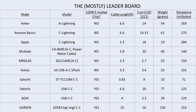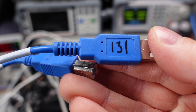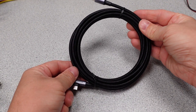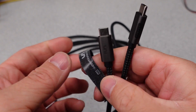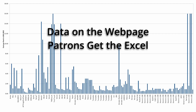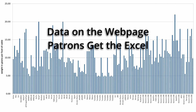Overall, Apple makes good lightning cables. Anker and Amazon Basics cables aren't bad either. For cables with USB-A connection, there are a ton of options out there, and the best way to figure this out is to look through the data for what you need. Remember, none of these will support power delivery, so you're mostly stuck with 5 volts or old versions of the QC power modes. Once you get into USB-C to C cables, basically everything on the list is acceptable. The general consensus is to use the shortest cable possible. If you need to go at 100 watts, make sure it's got the eMarker chip. The Ugreen 10-foot is the best of the longer cables, the runner-up is the 10-foot Uni cable, and the honorable mention is the 15-foot cable. This is why it's all on my website. There's a USB 3.1 PD 140-watt cable, which is the best of the 3.3-foot cables on the list — it's from eBay and it's not very expensive.